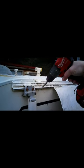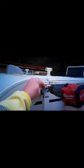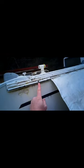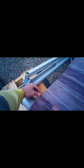New awning came in, so I'm going to try to get it on today. You want to prop these rails up on something, because I'm going to cut this old awning off to slide it out. I'm going to prop both sides up. I'm going to remove this screw. This is a number 2 square bit on my camper anyway. Then I'm going to remove this bracket. It's a 3/8 socket on this camper. There's another one of these screws on the other end that I'll have to take out.